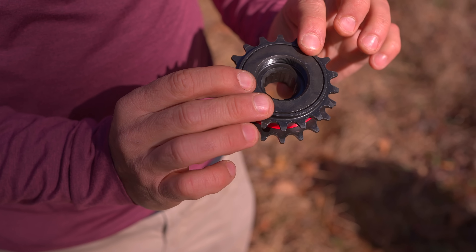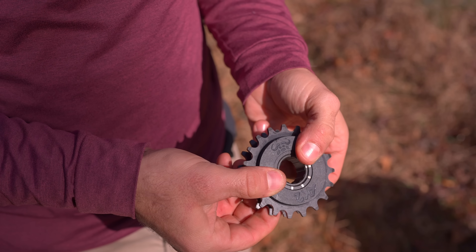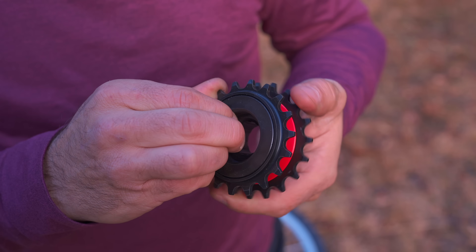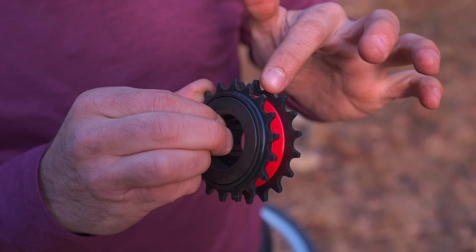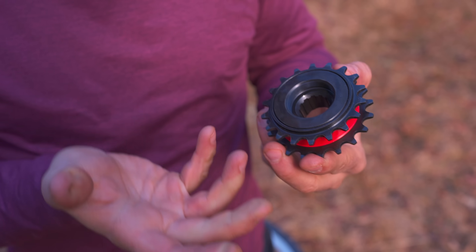This is remarkable — all the shifting is inside of one part. At the backside here, it performs just like a normal freewheel. If this mechanism fails, you would still be able to use the bicycle. You can see it turning the freewheel there. If we backpedal, now it's just pedaling and not doing anything — this gear is disengaged, therefore this one defaults. It's crude, it's simple, and it's kind of brilliant.